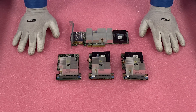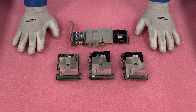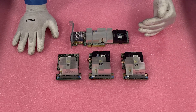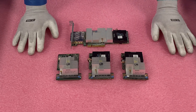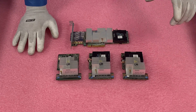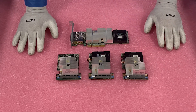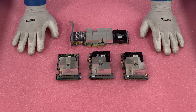Let's start by going over the different RAID options. We have the main hardware ones featured here. The difference you'll notice is these are mini monos and this is a PCIe card. Both work great. I personally prefer the mini monos because there is a dedicated spot in the R720 for it, whereas with the PCIe you have to use one of your PCIe slots. So personally I'm a big fan of the mini monos, but both work great and we'll show you how to install both.